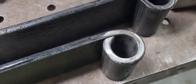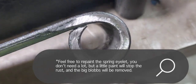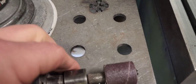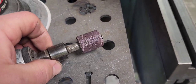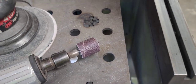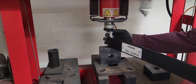Here's a side-by-side — I've got the paint prepped off of there, and then just use a little tootsie roll brush to clean the inside of it so there's less crap to push the bushing through. You can buy these at McMaster for pretty cheap — I think the little arbors are about three bucks and the tootsie rolls are maybe 50 cents each. We just use that to dust the inside so the bushing presses in easier.